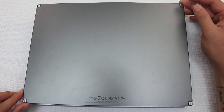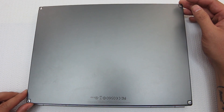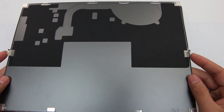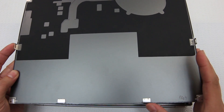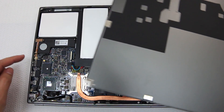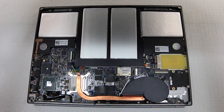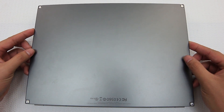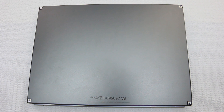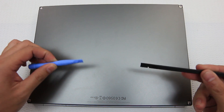Sorry, I don't have a video showing you how to take it apart — it was very difficult and I needed my concentration on it. Essentially, what's on the other side of this are these little latches. This is what makes it very difficult to take apart because you can't just pull it straight out — these little hooks are latched on to the chassis. There's also a little bit of glue on the top and bottom edges. When you pry it apart, always use a plastic spudger for this type of thing. You don't want to scar it.